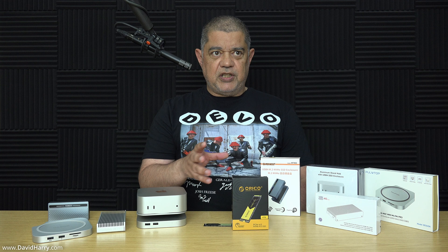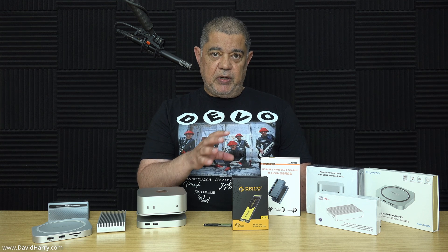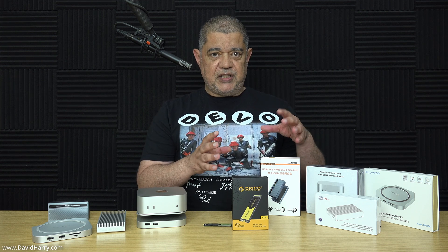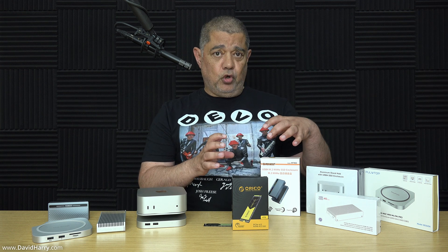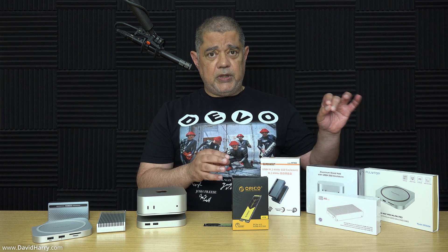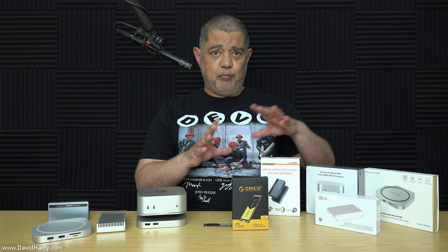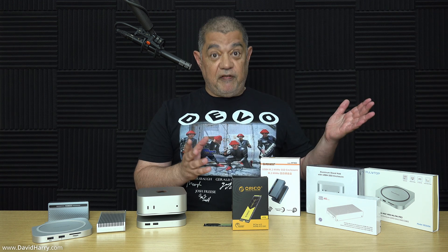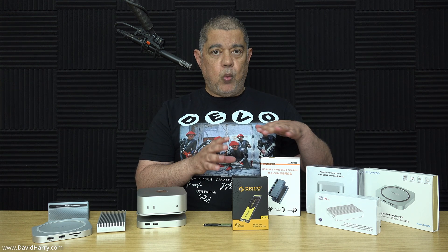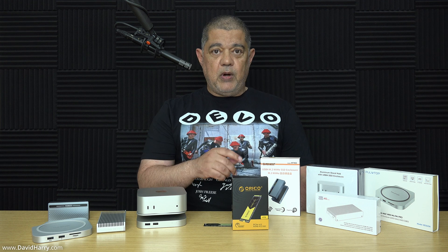So it's not all roses — it won't do its fastest speed forever. It will drop. However, if you give the SSD time to refresh its SLC cache it will return to fast speeds. Of course the more you fill up the SSD — and this happens with every other SSD too — the SLC cache will run out more quickly. The more it gets filled up, essentially the slower the SSD becomes, because the SLC burns through really quickly. The drive then starts writing to its long-term NAND a lot sooner once it's more full.